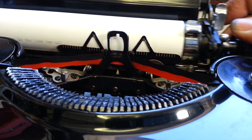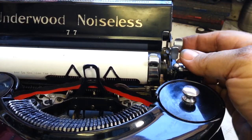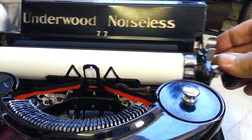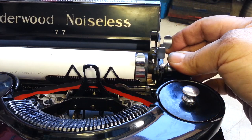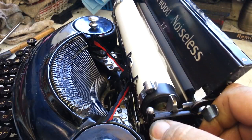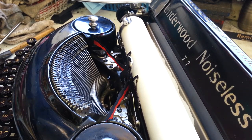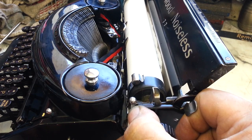I think that one carriage release over here on the side is not pulling far enough. So this one grinds, but this one is okay. There's a little bump in the... Oh, that's probably, yeah. I thought it was going to be one of these guides, but there's something. I feel a little something. Oh, it's a carriage lock here. Slightly touching here. Carriage lock assembly is out of adjustment slightly.